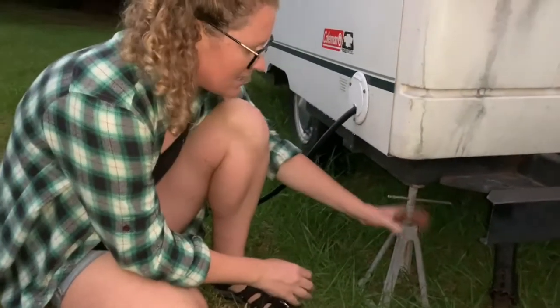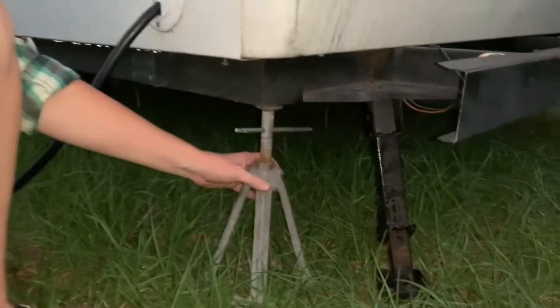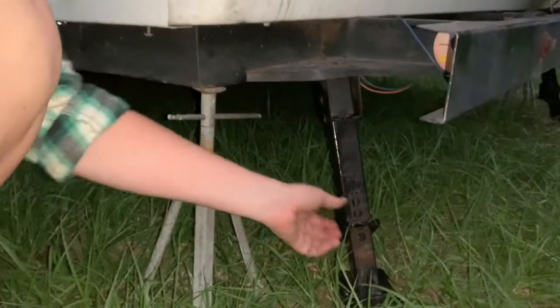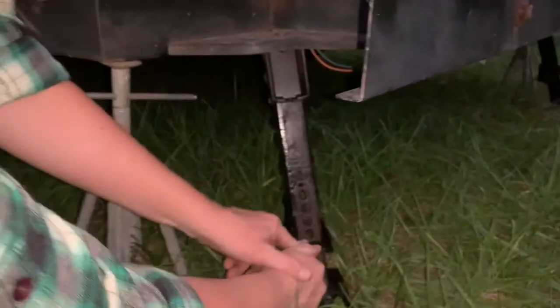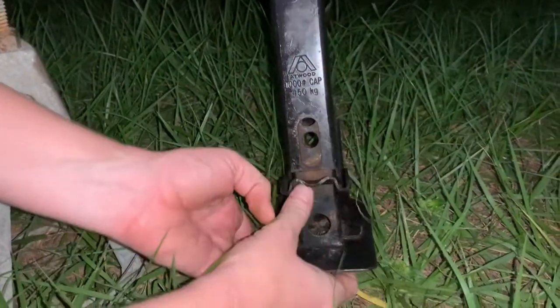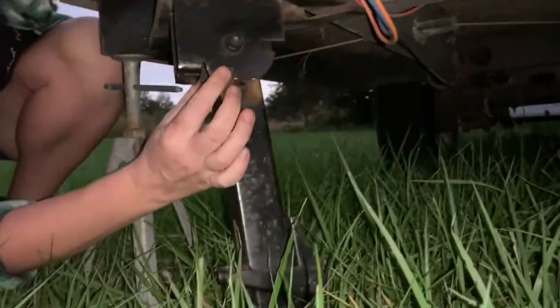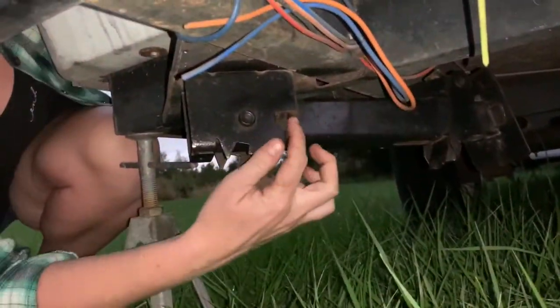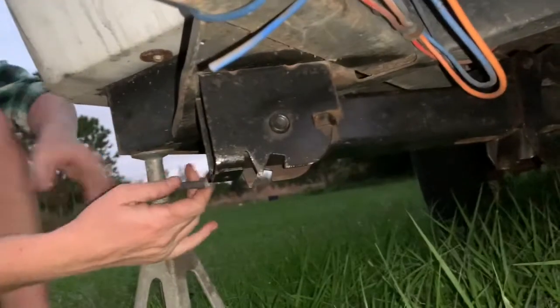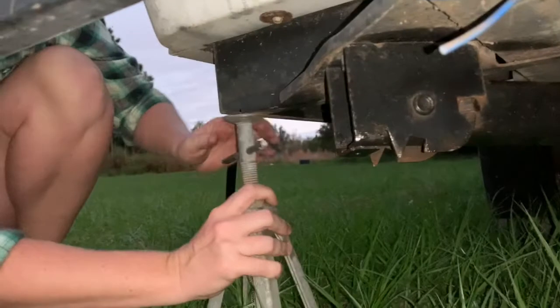The stabilizer jacks — I forgot what they're called now. You're going to press down on this stabilizer jack right here, and that will allow you to lift the foot up. Then you're just going to push up on this to lock it. Pull down to release from this. Push it in and the spring should pull it right in there and lock it. Then you're going to lower these jacks enough so you can pull them out.